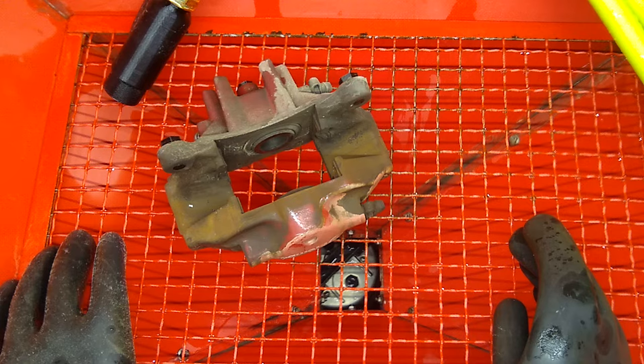36 grit garnet is so big, it's about the size of coffee grinds, so it's gonna muddy up the glass here real fast. But this will be the test for the vinyl coating that we have on the glass right now. We'll see if it can withstand the garnet bouncing off of it and whether or not the garnet's going to tear it up. Also, another thing that we want to check out is to see if the garnet is going to damage the 3D printed gun. I would imagine over time it's going to wear it out, but I want to see how long it will go before failing on us.